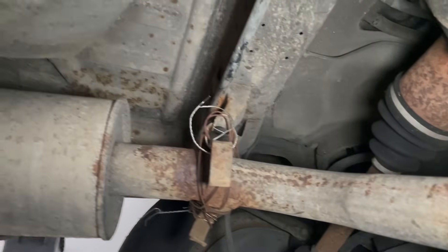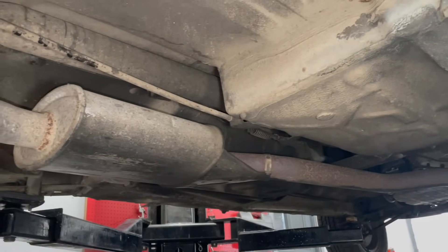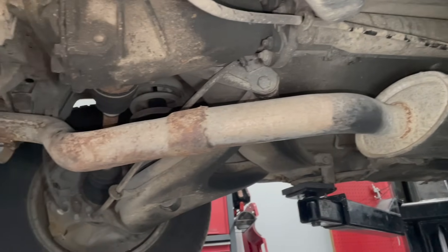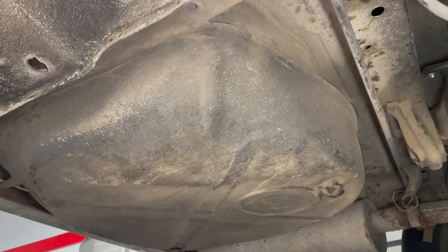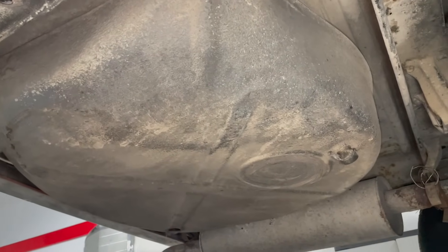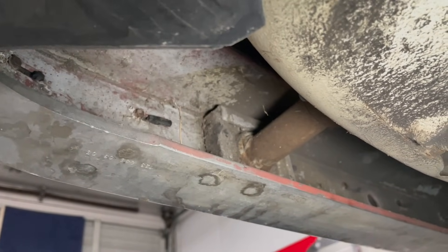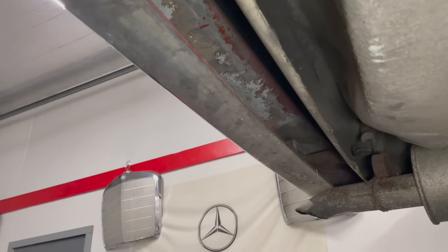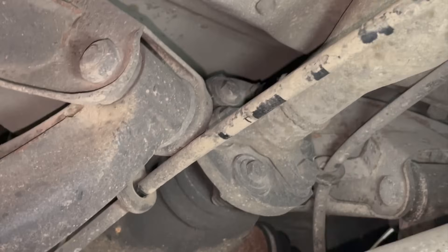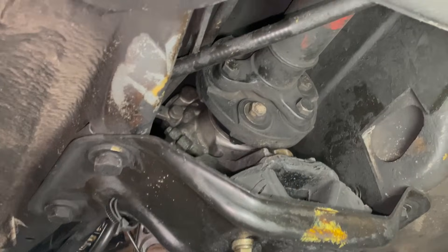We do have donut deterioration — you know how much I love donuts. The exhaust system looks good and sounds good, so I won't have to do anything with the mufflers. The rear pan for the spare tire is not all dented up — that's really nice. These rear bumpers will corrode up in there and when they do the bumper can fall off on the road. That's aluminum and it will disintegrate if exposed to road salt, so we have a car here that I believe has never been subject to road salt. The flex discs are old, but I don't see any cracking in either the rear one or the front one.